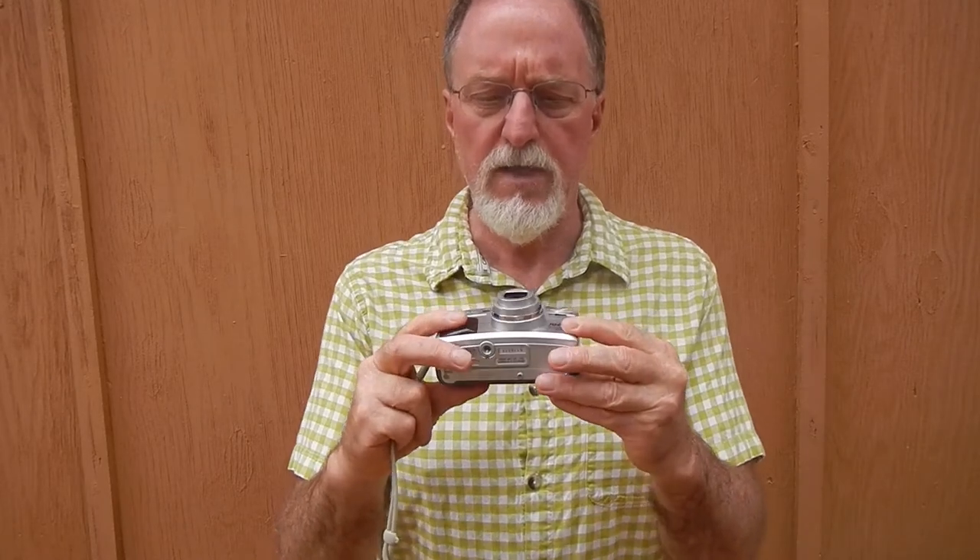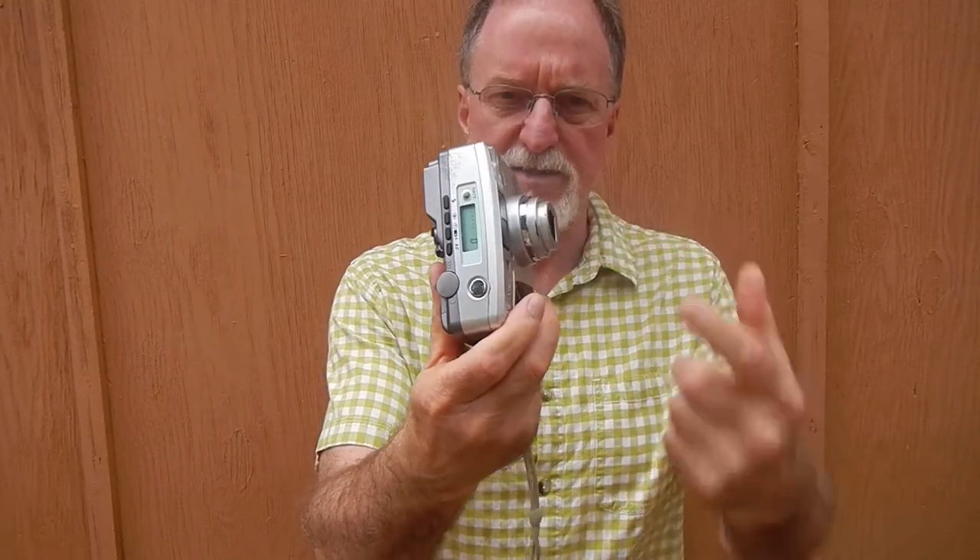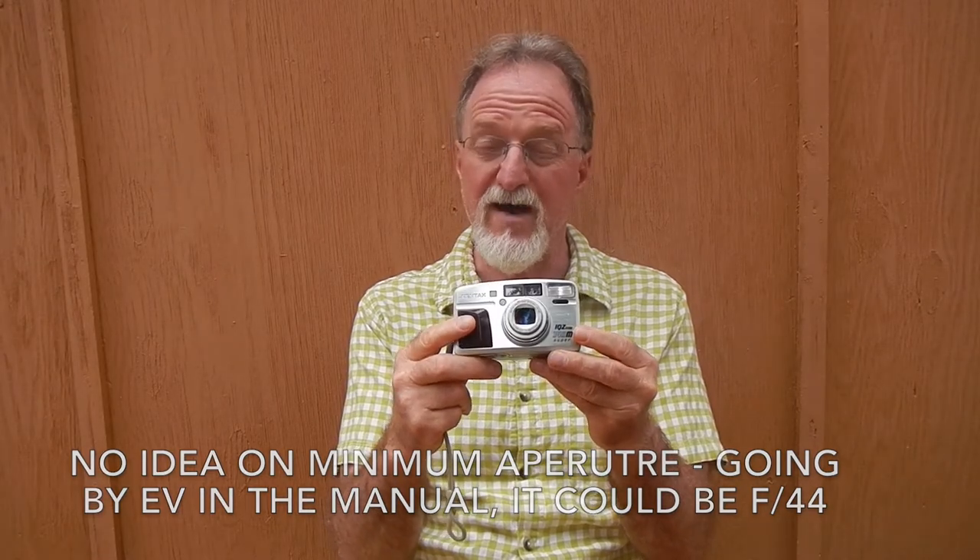So somewhere around the turn of the millennium. It has an SMC Super Multi-Coated Pentax motorized zoom 38 to 145mm. This one actually says 140mm — the piece was on upside down and there are signs it was dropped, so I'm pretty sure it's a replacement poached from another camera. This is actually the 145mm. It's not a super bright lens — it goes from f4.8 at 38mm to f12.5 at 145mm. It's eight elements in six groups, with a close focus of 0.8 meters, about two and a half feet.